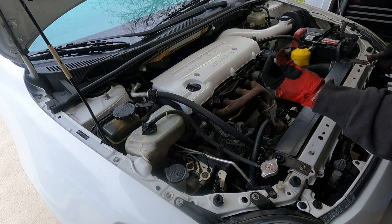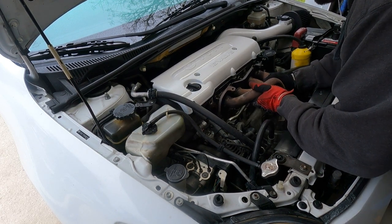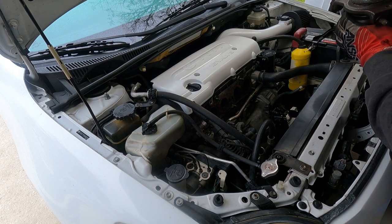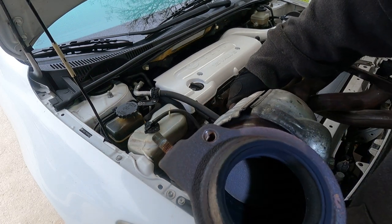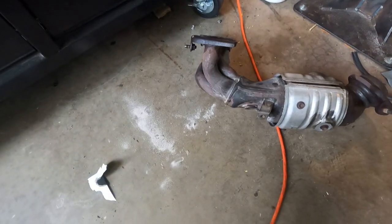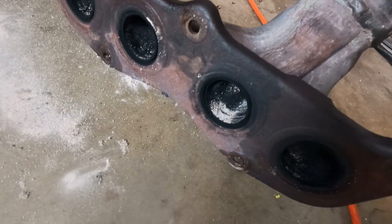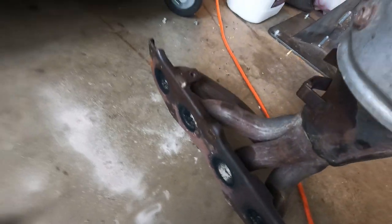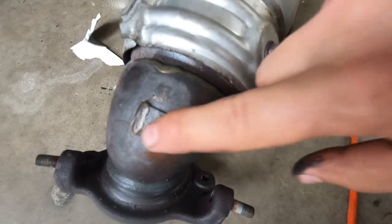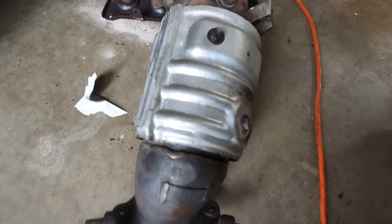Overall they all came out pretty good — they weren't seized or anything, so that's a plus. We just pull it out nice and easy. I don't know if you can see that but the catalytic converter is intact — it's not broken or anything, so I wasn't sure what to think. But I flipped this over and had a bunch of sand come out of there, so it was definitely bad because it's not supposed to do that. This is the original Toyota unit — you can see it right here. I'm going to take this heat shield off and transfer it to the new one, then install the new catalytic converter.